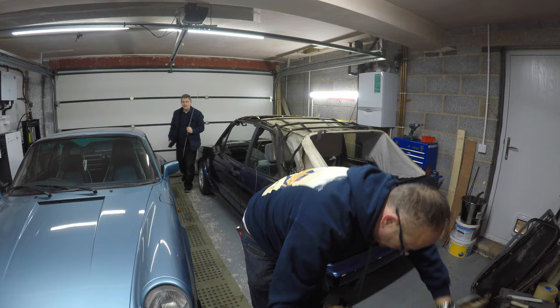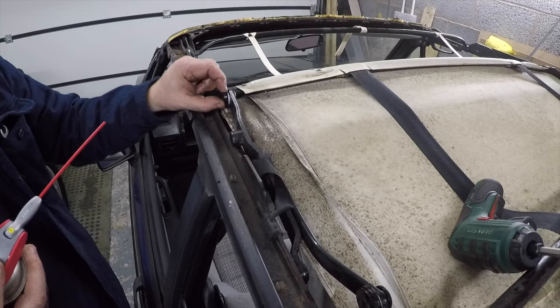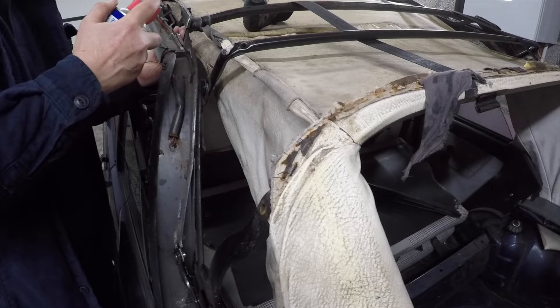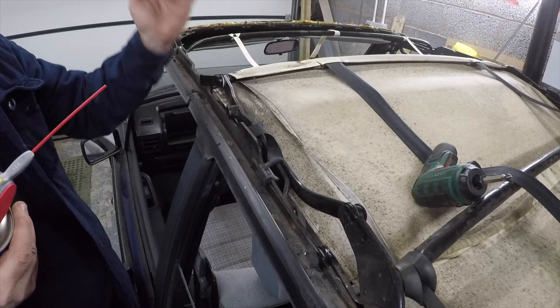On the framework together with these pins - these are hydraulically pressed in at the factory, there are little spacer washers. What happens is because people don't tend to maintain or oil the roof, over the years the moisture gets in and the rust attacks the plastic and the plastic snaps, crumbles and falls out. How would you get in to do that if it's all enclosed? Well, with the roof open halfway you can actually access all the various hinge points. You can see the plastic spacer washer here, and then we end up with what's called frame shake - whereas the frame goes up and down, these hold the frame in the correct position as it raises and lowers.